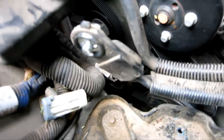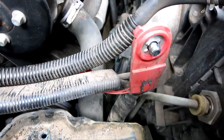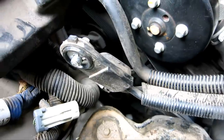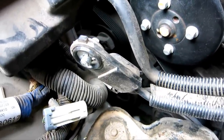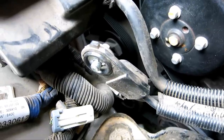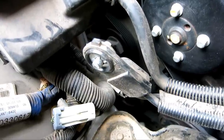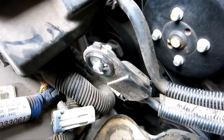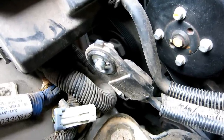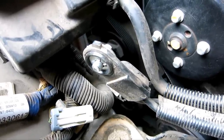You always want to inspect the terminals. As you can see, both of these terminals are in good condition — there's no white powder or corrosion on them. If there is corrosion, you want to use a baking soda and water mixture and clean the contacts. That will improve the conductivity of the leads. You can also apply some terminal grease that you can buy at your auto store. For this scenario they're clean and good, so there's no need to apply that.